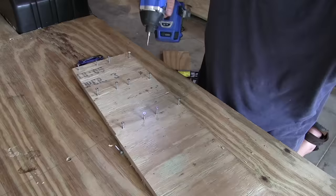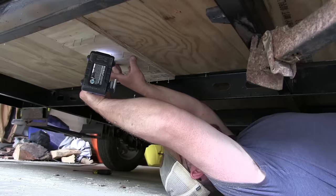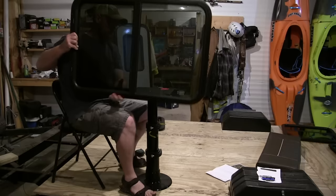This time I remembered the glue ahead of time — a lot easier that way. A couple of clamps really makes it a lot easier to keep that plywood in place when you're trying to run screws in from the bottom side. This sheet of plywood will bridge the gap on the long seam. It makes a huge difference in the stiffness of the floor.